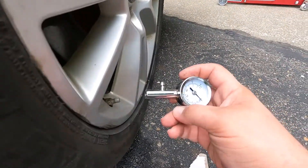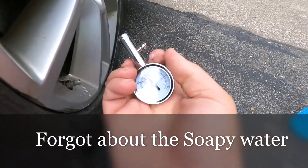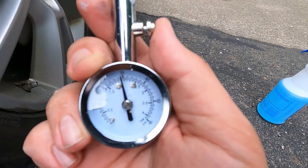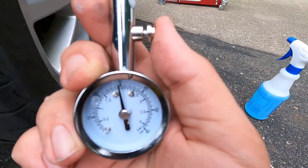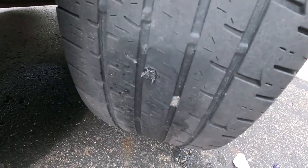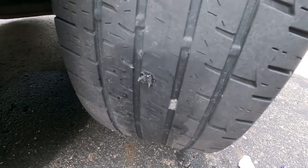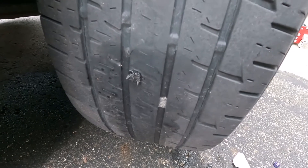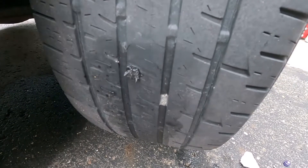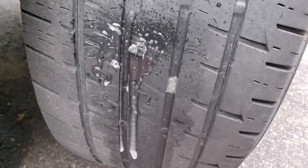That's in, and we'll check the tire pressure real quick to see how well we did. It's just short of 30 PSI, so we only lost about 4 PSI doing that. You may lose more if the full weight of the vehicle is on it. But you can see putting a plug in real quick is fine to do in a pinch and is relatively quick. Again, this is an emergency kind of thing and shouldn't be left in there for very long. We can hit it with a little bit of water real quick just to verify that it's holding.